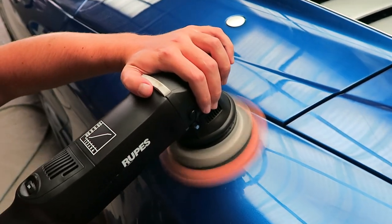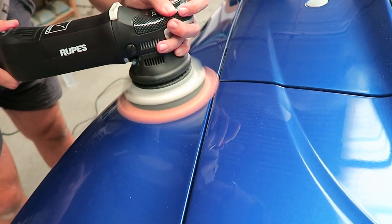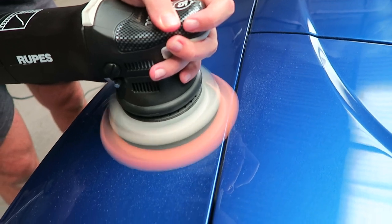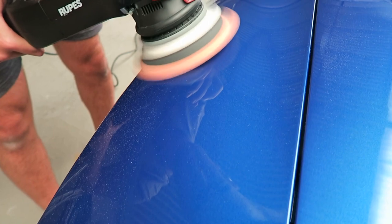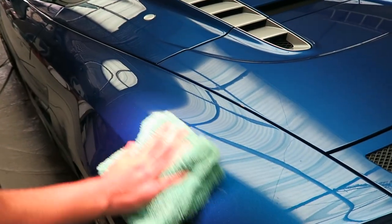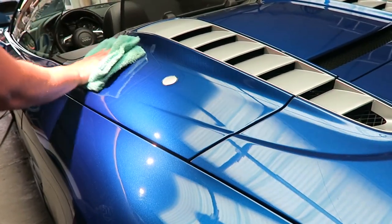A one-step was actually enough to remove about 85% of the swirls and scratches from the car. My dad doesn't care too much about scratches and swirls, so I just wanted to start with a new layer of paint by removing like a nanometer of paint by polishing it. In my mind it's good to know the paint has a completely new clear coat to bond the wax on. I've found over the years that when I polish a car and then wax it, the wax actually has a lot more durability. The Sonax Perfect Finish really finishes up to a brilliant gloss — you can barely see any product on the car still, just a little bit of residue to buff off.